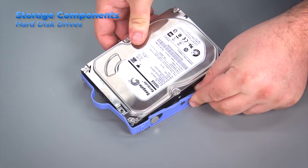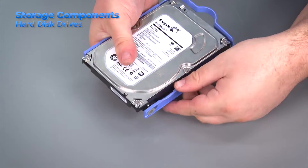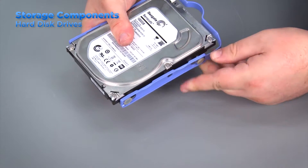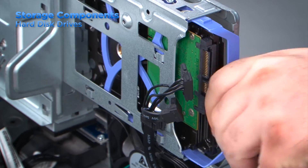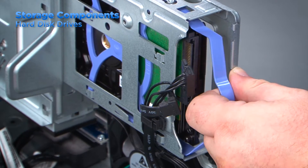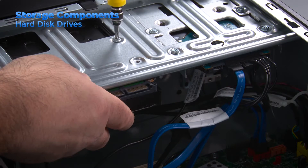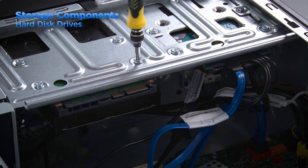In a desktop system, hard disk drives are typically installed into a bracket that helps to keep it accessible without using any tools. To install the drive into the bracket there are pins that fit into the screw holes along the side. The bracket is flexible so you can insert the pins into one side of the drive and then pull outward on the other side of the bracket to install the other two pins. The brackets usually slide into position and lock into place and can be pulled out by grabbing the handle and pulling the drive bracket outward. Not all desktop systems have a tool-less design and because of this some hard disk drives are mounted to the chassis with screws.